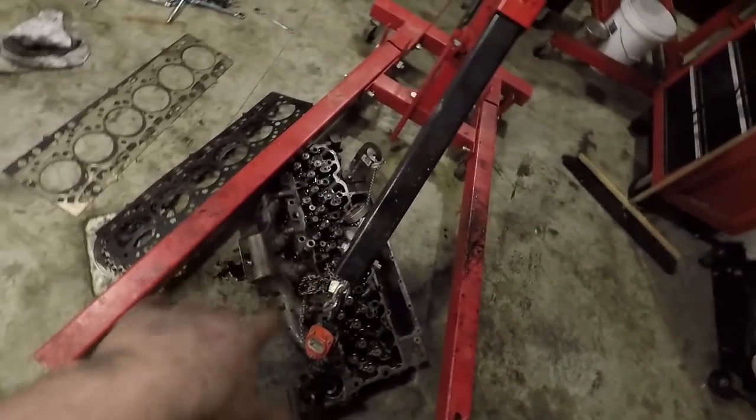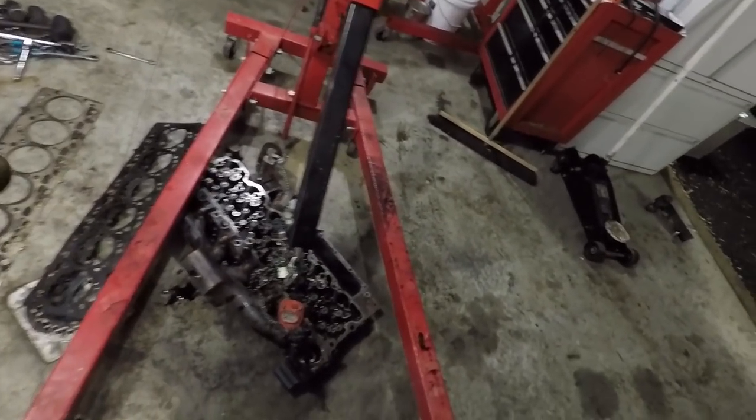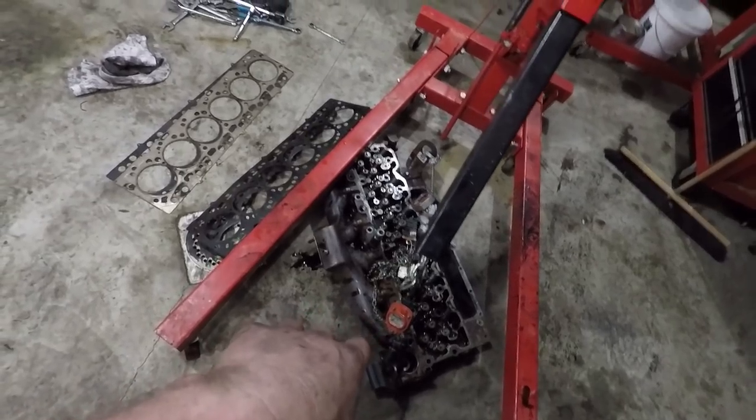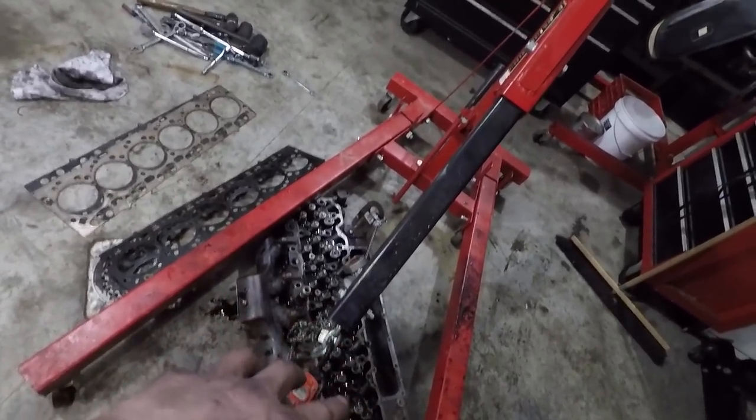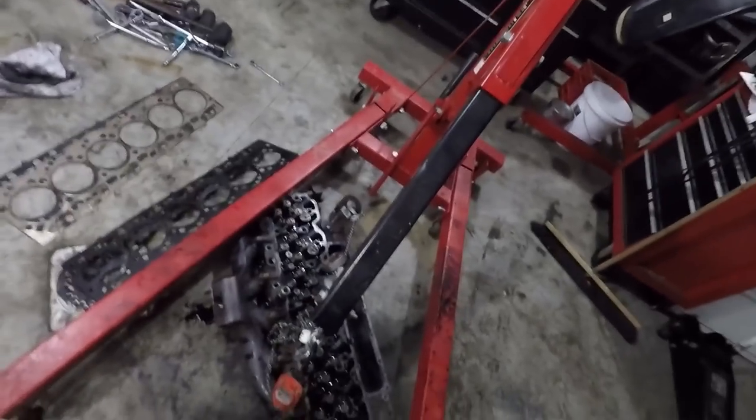Other than my little screw-up, we had a pretty good night in the garage — we got a lot of stuff done. Very good progress for a school night, that's for sure. But the head's off. It's sitting on the floor — I want to clean it up, we've got to get the manifold off, get a couple sensors out of it before we take it to the machine shop. Get them to deck it and all that. I haven't decided whether I'm going to O-ring it or not — but seeing that head gasket, I might end up just O-ringing it for the hell of it. Anyway, that's how to pull the head on your 6.7 Cummins. Hope you guys enjoyed the video — please like it, subscribe to the channel, and I'll catch you guys on the next one. Get out in your garage, get to working on your truck, and try not to smash anything.